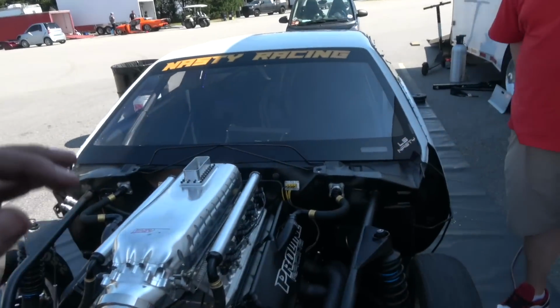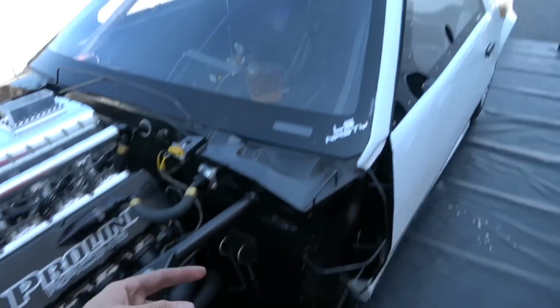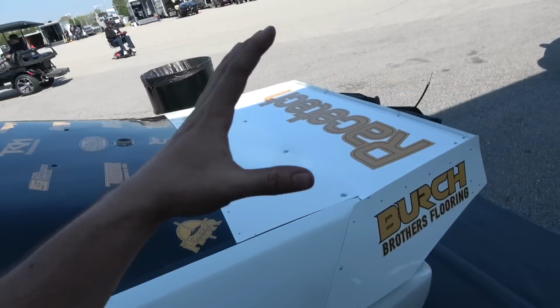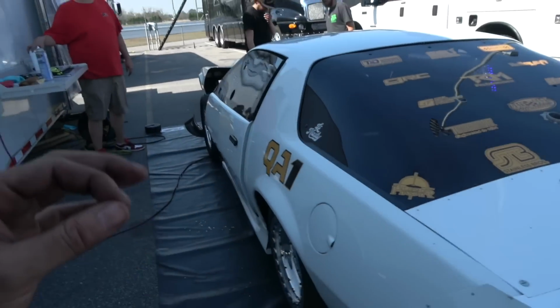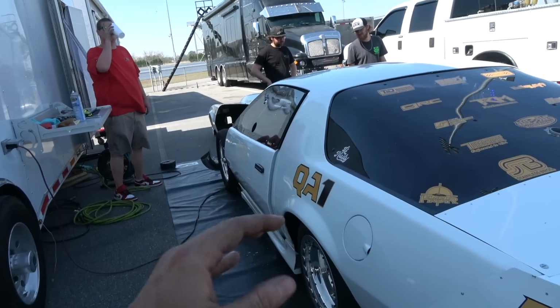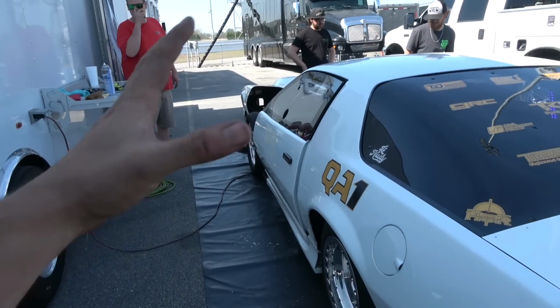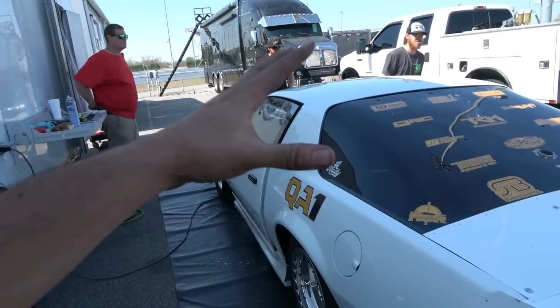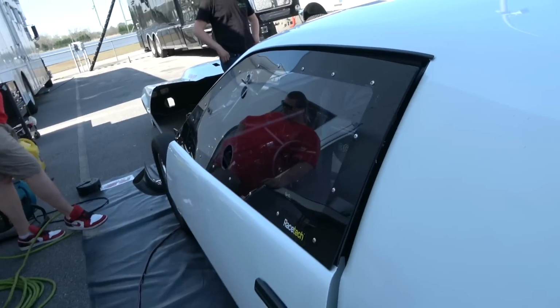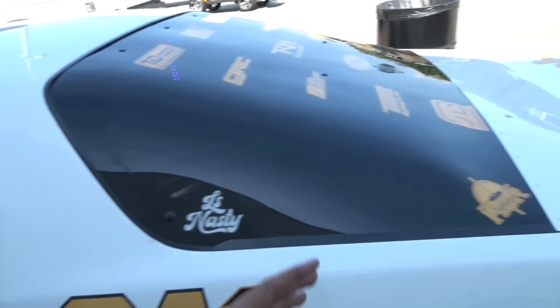So we were messing a lot with the brake bias, messing a lot with alignment, messing with some bar angles in the rear, zeroed out the anti-roll bar. So this first pass, what we're gonna do is our burnout. We're gonna double bulb. I'm gonna leave like 50% throttle off the trans brake, drive out there, let the power come in, make sure nothing goofy happens, make sure it doesn't drive one way or the other, nothing weird happens. And that's where we're gonna start.